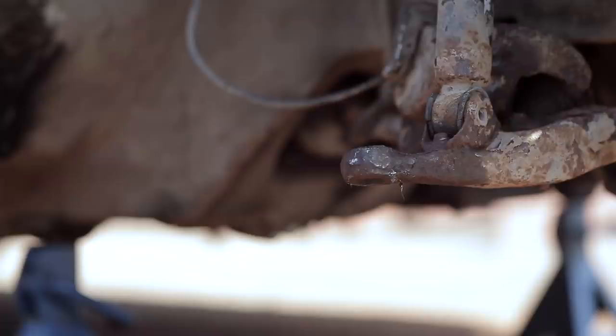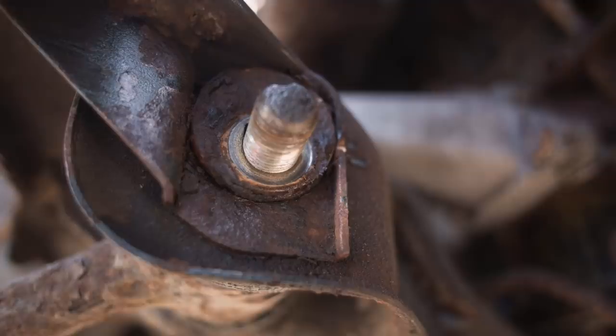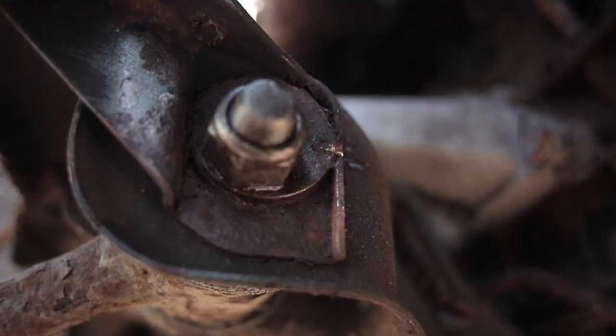This was out of shot on the near side of the car, but this is how I presume the toe out is adjusted on a Mercedes W123. The lower arm has a cammed washer at either end that, depending on its placement, will make a big difference to the position of the lower arm. So before we undo it, you see I've used the chisel to mark the washer against the mount it's in, so we know where to adjust it to on reassembly.